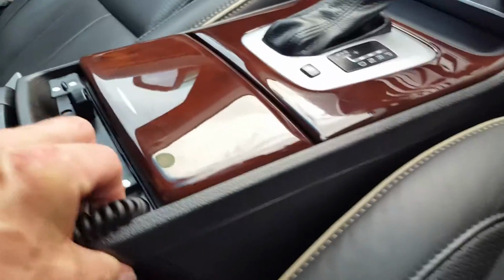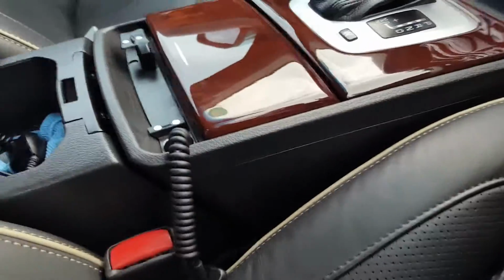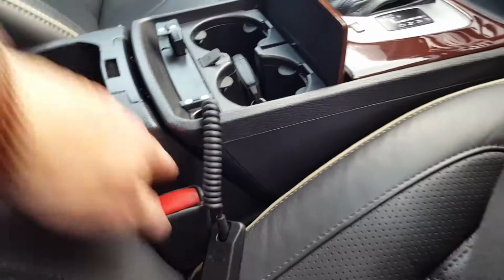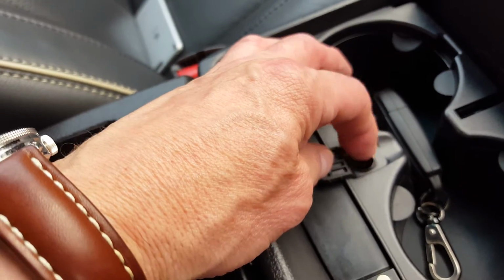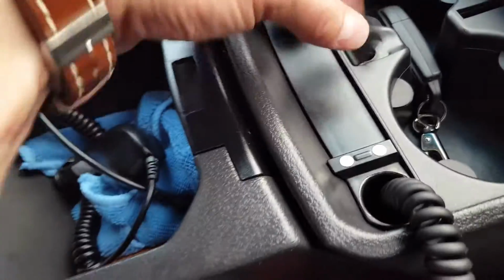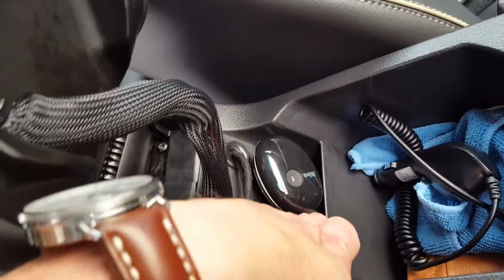You can then lift off this whole surface here and get access to the space under there, and then what you find is you're able to run the wire through that space and then pick up the auxiliary input jack here, which I've now popped down, so that's just a hole there now, covered over by that blanking plate. So the connection is made in there. Basically the connection is there from the analog output of the B-Link, and it works incredibly well.